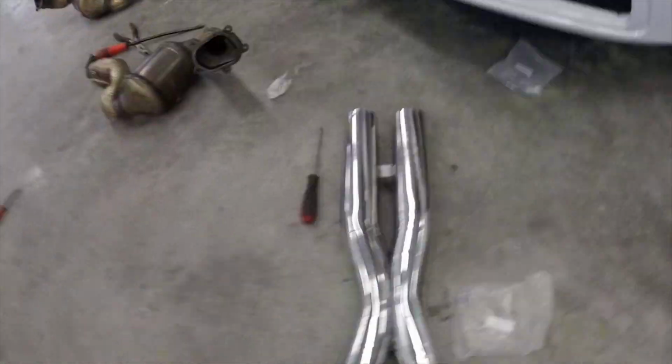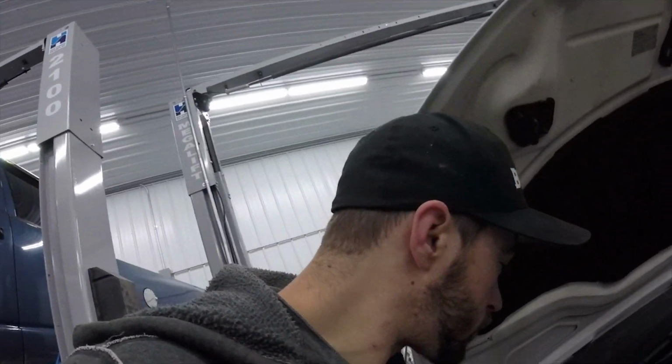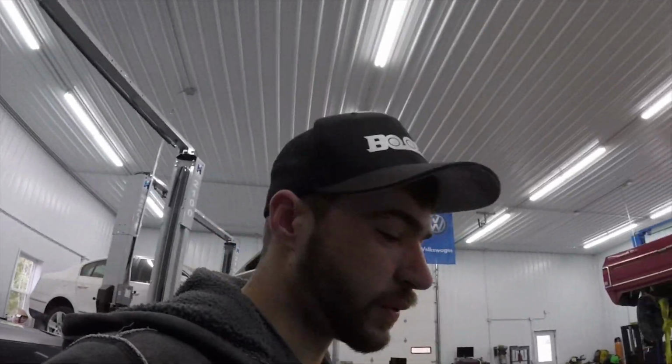It's actually off of, I think, a C6 Corvette, but it's going to be a lot easier than fabbing one up, so I'm going to use that. Probably going to have to cut off these ends here to get it straight, and then that'll go next. And then from there we'll just go dual 3-inch straight out the back, and then see how full straight sounds, and after that we'll add mufflers or resonators to get the sound where we want it. So until then, we will see you later.